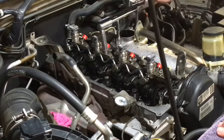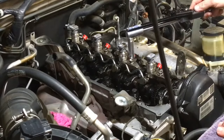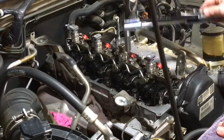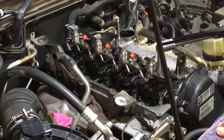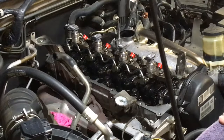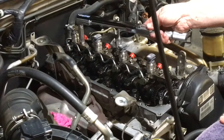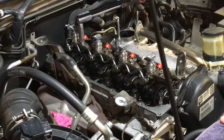Because ideally you want to be on the move. You don't want to stop and then start again, click. You want to be on the move, that is the correct way to torque something. And we don't really want to be undoing them again, doing it twice or changing washers or anything like that. So I reckon, I don't know how much further that's going to go, but I think this is it,